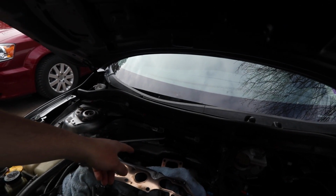Maybe it's the fact that I need my secondary O2 sensor. It could have also been the fact that I was on a base map. Base maps tend to run rich. It could have just needed a MAF calibration. I also noticed that the exhaust manifold was cracked on cylinder 2.